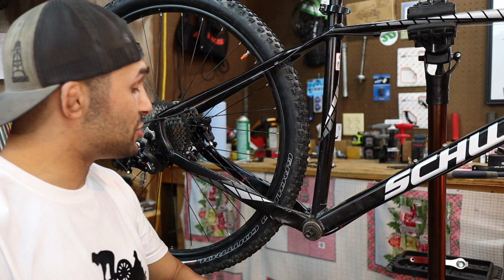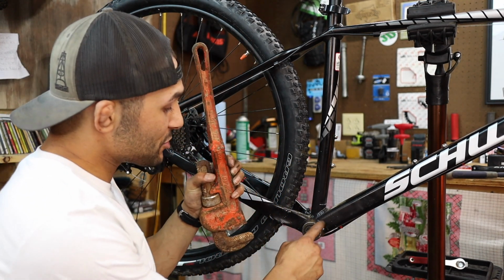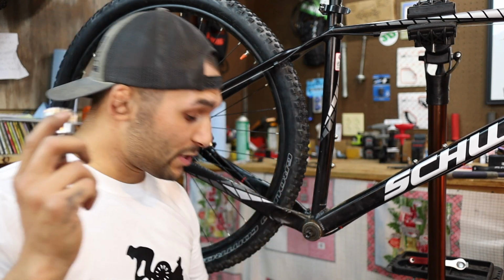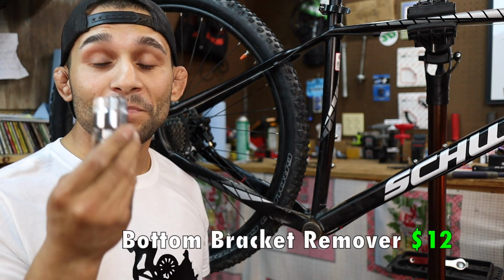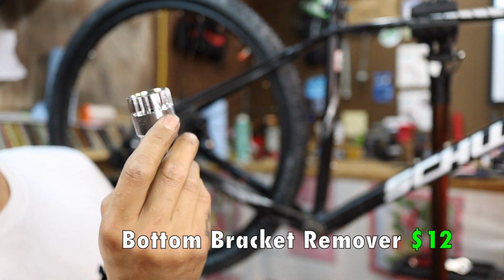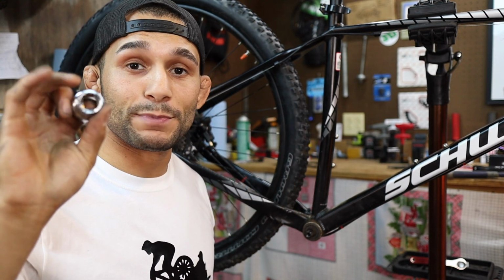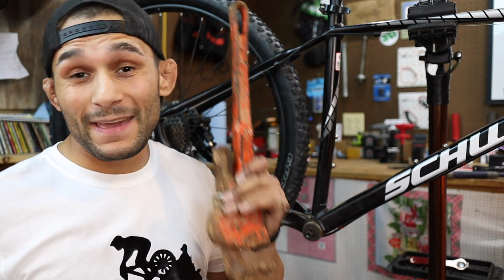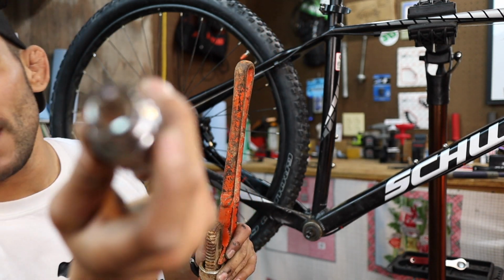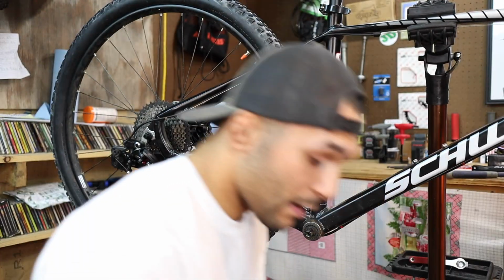Now what I was going to do, and show you guys my tool here, my monkey wrench, my pipe wrench, I was going to use that to take off the bottom bracket. But I forgot. See, I was already pre-planning and I didn't even know it. I bought a bottom bracket removal tool. This is a 20-tooth tool, and it's a 1/2 inch. If you have a 1/2 inch ratchet, you can put it on the back there. Or if you have a big monkey wrench or a crescent wrench, you can get the little hex head there and just put it on the outside. So I'll put a link to this one as well in the description.